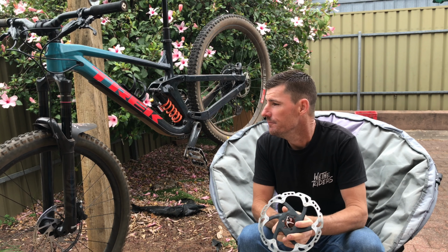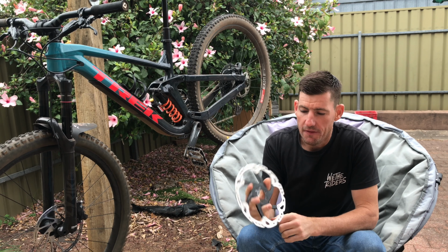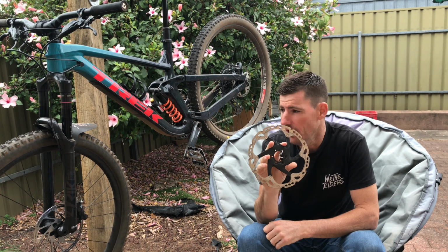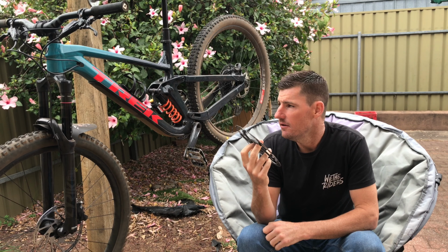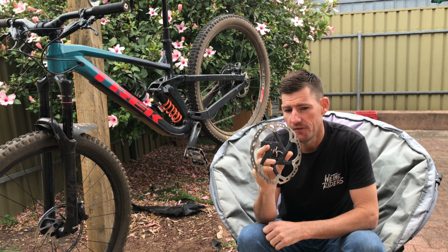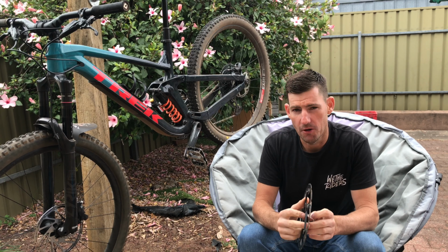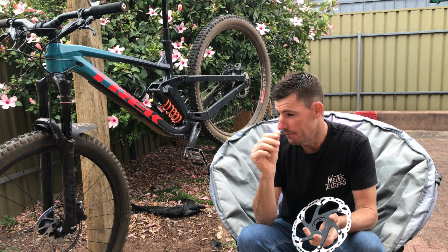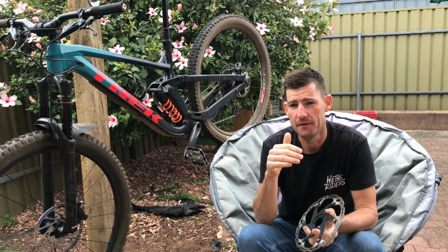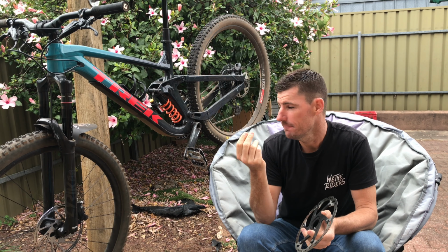They've been on there for a bit, and the idea was to test whether these are stronger, just the disc itself, creating a stronger braking bite than the Avid Centreline discs. Now, what I've learned from this test is the stuff that I use to wash my bike, the CT18 Super Wash, the car wash, must ever so slightly contaminate the pads bit by bit, and then incrementally over time the bite becomes less pronounced.